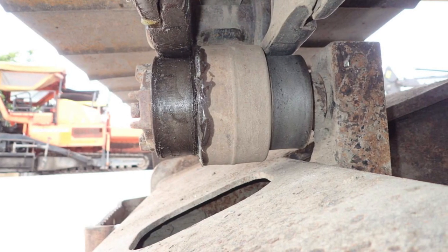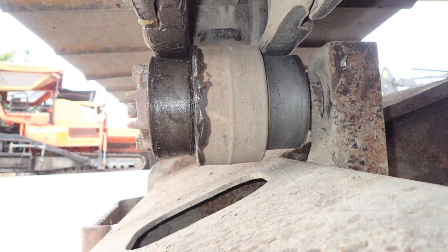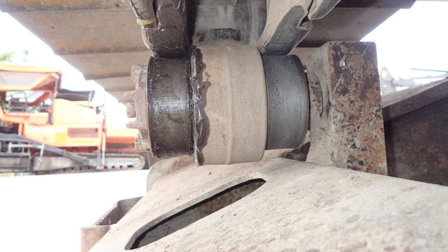This is a photograph of the side of the upper roller. Where the chain rubs on the upper roller it'll wear, and you'll be able to see how worn the rollers are. If they're worn they'll curve like the left hand one there, and if they're not so worn they'll be flatter, like the right hand side of that roller.